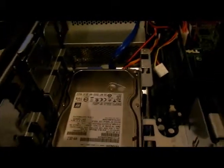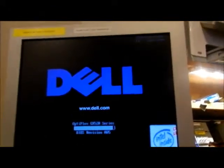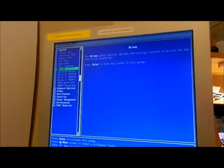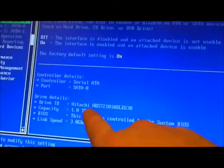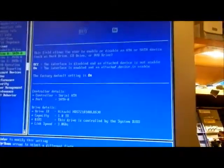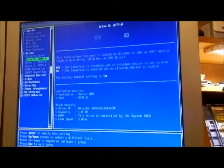It now has Windows 7 32-bit on this Dell computer. I want to go into the BIOS first — hit F2 to bring it up. I want to go into the BIOS and see what it lists for the hard drive. Let's go down to Onboard, go to Drives. Drive 0 — and there it is. Hitachi, 1 terabyte. The drive is controlled by the system BIOS, so it's in there. Now we're going to boot up, let it go all the way through and bring up Windows. Let's hope it works. Exit setup, let's see what happens.